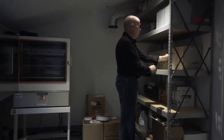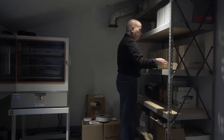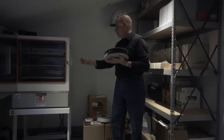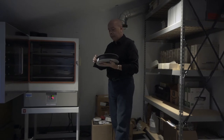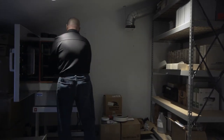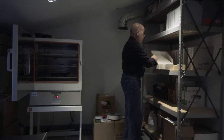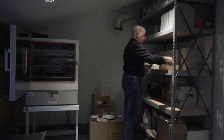Tape baking — what is it and why is it so important to the archiving process? Tape baking is the process of removing moisture from the binder layer of any tape, solving the problem of what is commonly known as sticky shed syndrome — the accumulation of moisture in the binder layer. A tape is three layers: back coating, binder, and magnetic particles on top.